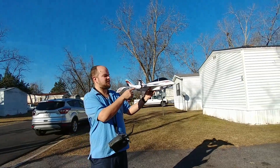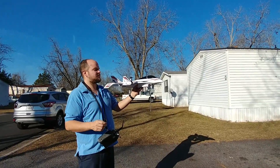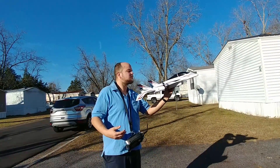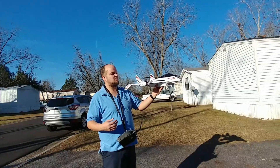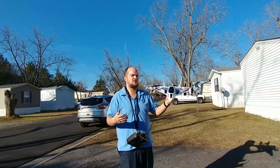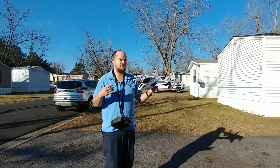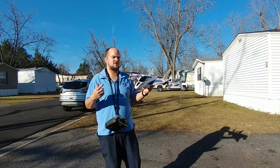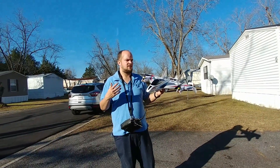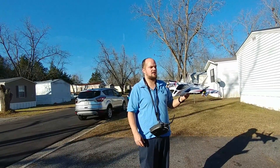I will say these servos do work a lot — they're non-stop making noise. That's why I'm gonna put some better gears, probably some Savox micro servos. The only aftermarket servos I buy are Savox. I've used one HiTec — it was the ultra torque — and it completely blacked out on me on my Baja. I hit the brake then went to give it gas and it had died, so I stay away from HiTec and I always go Savox.